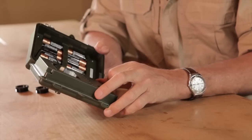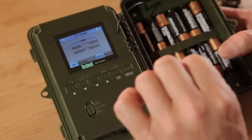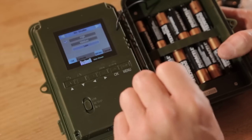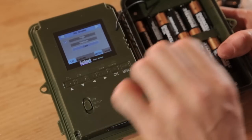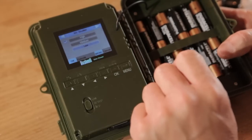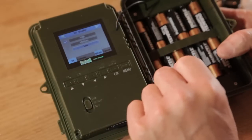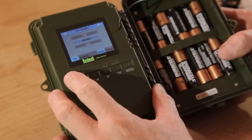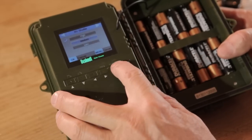Night view shutter is the shutter speed during the night whilst it's working with infrared. If you set it to high, motion is likely to be frozen but the lighting will be darker. If you set it to low, there'll be a slower shutter speed with more light coming in but movement will be blurred. So medium is a nice compromise. This setting is relevant to still photographs, not to video.